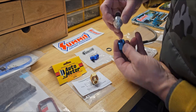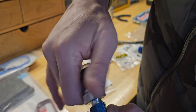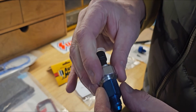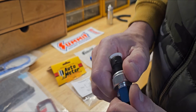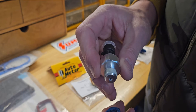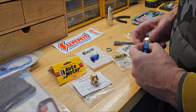It's probably going to bottom out on the threads. You can see it's going in very loose. I know these are pressure fittings and I could probably just crank it down and it'll be good, but I do want to put some Teflon tape on the threads so I don't get any leaking or blow-by, so that's going to be that piece.